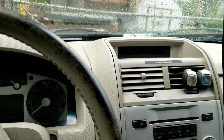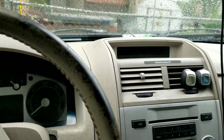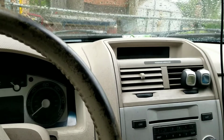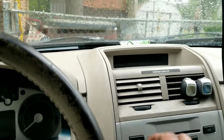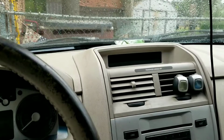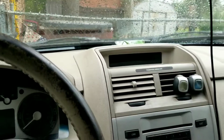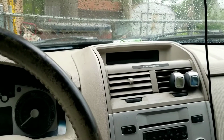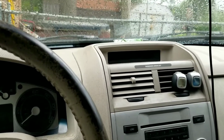And what happens is, when the cold weather hits, the solder shrinks, as everything does in cold weather, and it loses contact with the circuit. And the same thing's happening with my display panel here. If the temperature outside gets below 50 or 55 degrees, the whole display stays dead or blank until I've run the car for a while and the temperature warms up to 60, 65 or so.